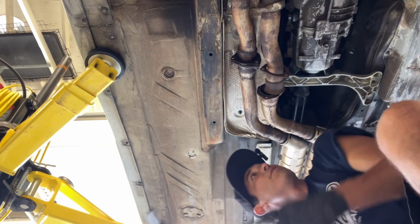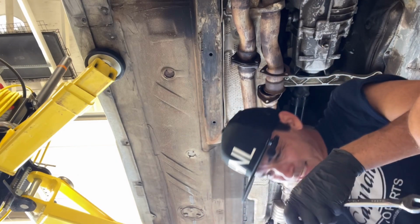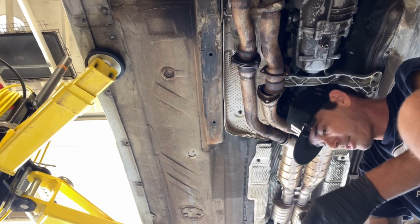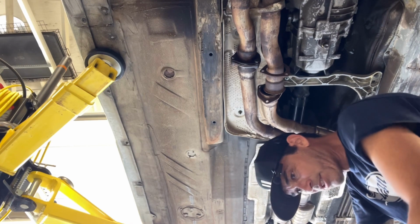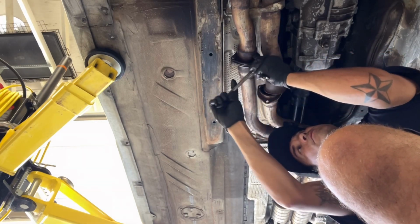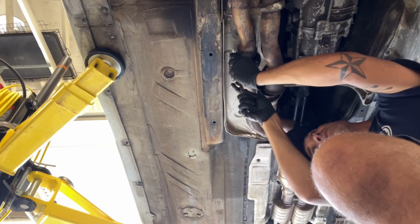Foil heat shields there. You can just bend them if you need to. And you know what? While you shouldn't, it's not that big of a deal, and everybody knows it. I know they provide a little air pocket, that's the whole point of the heat shield. But this is a very small section, so it's fine. Yeah, this exhaust is super solid. This thing was wobbling everywhere earlier.